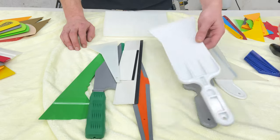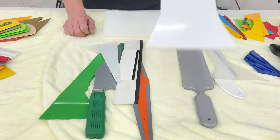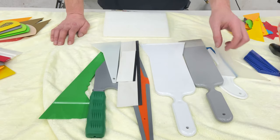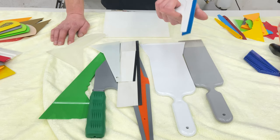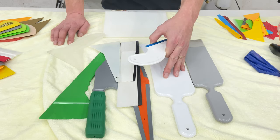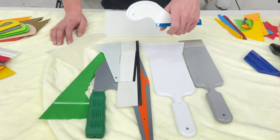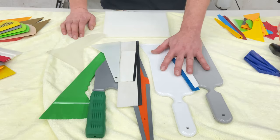The second tool I highly recommend is the Bulldozer Auto. This is the one that's gonna reach you to the bottom of those really tight areas between the deck and the glass and also get behind most of your third brake lights. Those two, if you were to ask me what to buy, buy them. Third one is the side swiper. You can do most of the bottom corners with this, but there is some aggressively curved back glass in the bottom corners that this long flat area just doesn't want to mold to. So this is what you're going to get down in there and side swipe the corners out with. So these three I highly recommend.